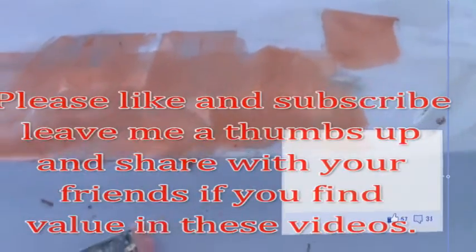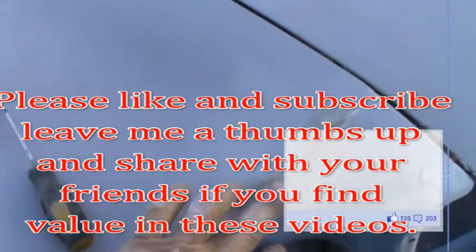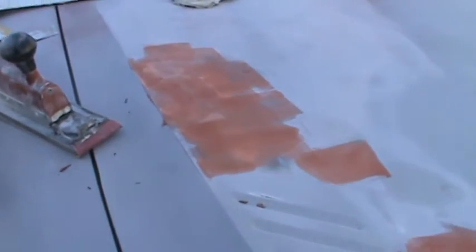Moving on here to the hood, I did a little guide coat, and I found a few low spots. Now this is a red glazing putty. It takes quite a while to harden and it shrinks. I prefer this gray stuff here. It's a harder putty, but this stuff's real easy to sand, but it does take a long time to harden. I bought one tube of it. I was going to use this for my final pinholes, but I just thought I'd throw a little on here now and see how it worked out and how it sanded and stuff.